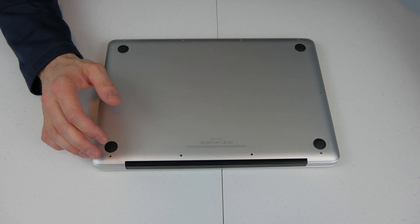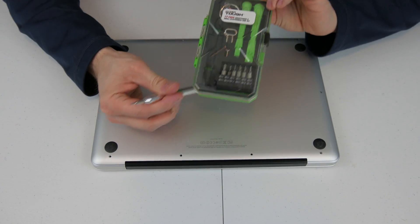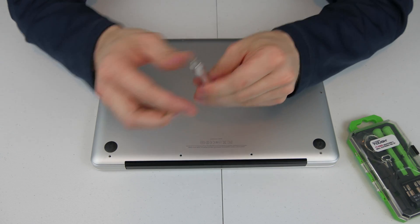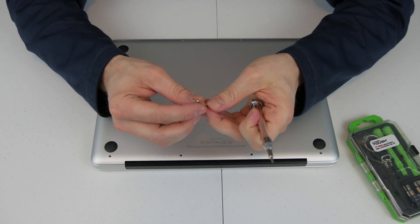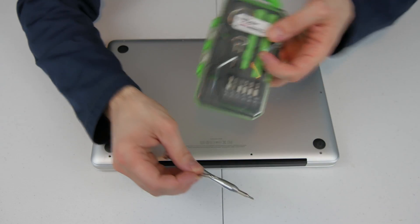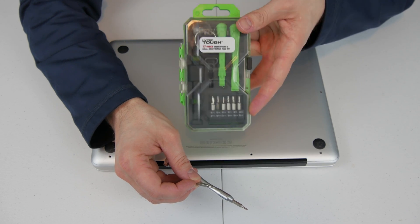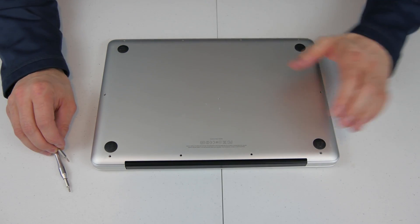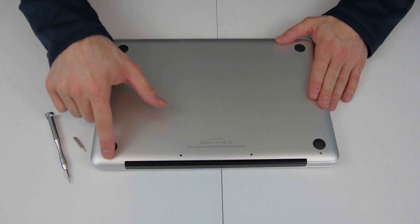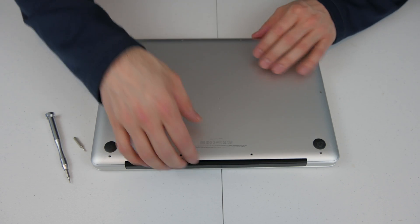Let's go ahead and jump into this. Before we get started, you are going to need a nice little electronic screwdriver kit. I only need the Phillips triple-aught and then a Torx T6 bit — that's all you need to complete this project. One of these kits is really reasonable and I will link one in the description. For the sake of this video, I did already remove the 10 screws on the outside. The three on this side are actually longer, so keep that in mind.